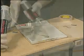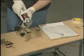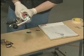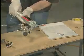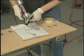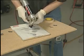Install the Fuser 804 cartridge into the Fuser sprayable seam sealer and coating dispensing gun, stock number 312, and adjust the air pressure feed in the range of 45 to 60 psi. Then spray out a small amount of sprayable seam sealer to attain the seam sealer texture and pattern desired for a factory match.